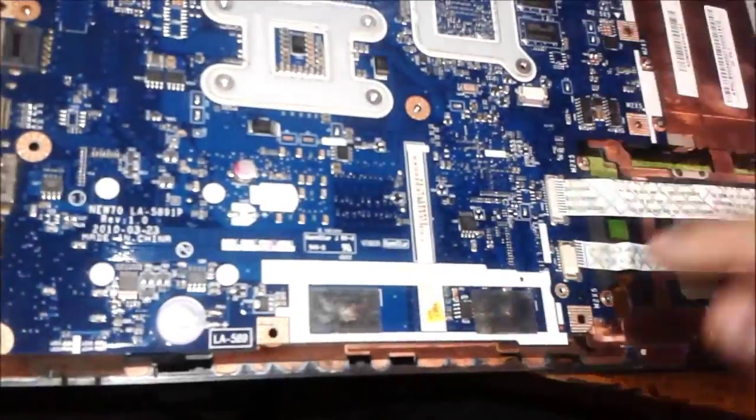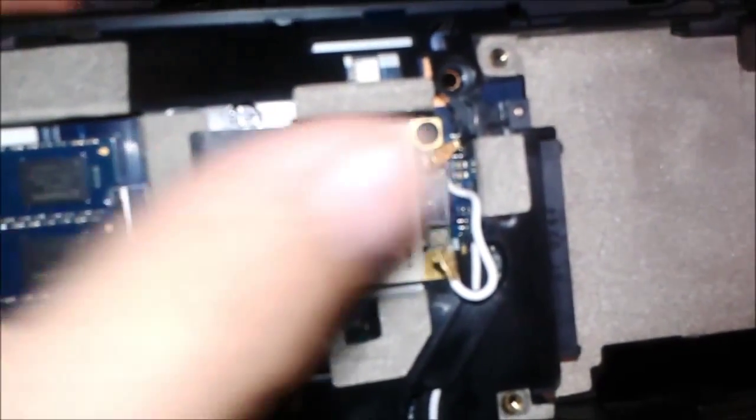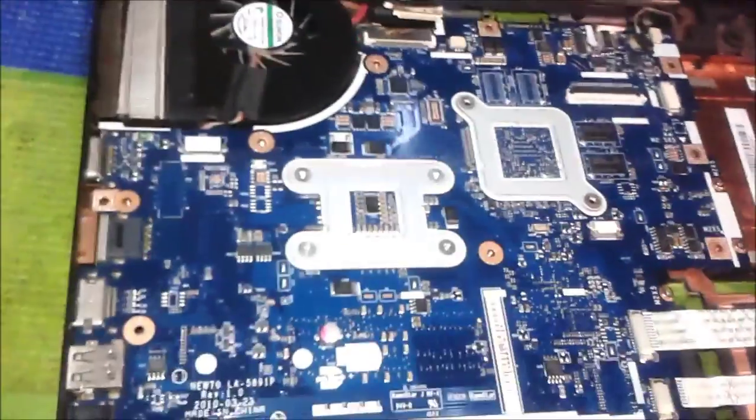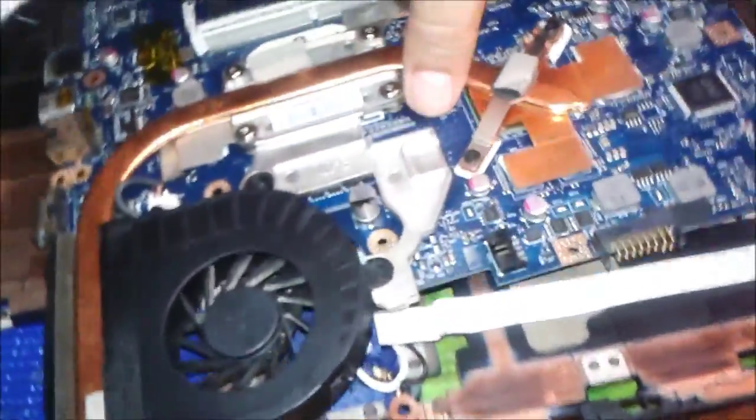Now we want to open this motherboard — there's almost no screw on one side and we have to open the bottom side. The wireless card is also holding a side screw and the plastic piece of the casing, so once we pull up the motherboard this card cannot go — we have to open this card also. Opening the screw first, the wireless card comes out. Now you can see the other side of the laptop — the motherboard is out. You can see the fan, memory cards, and everything. We also remove the charging power cable — now the motherboard is safely removed.